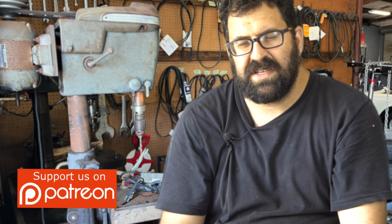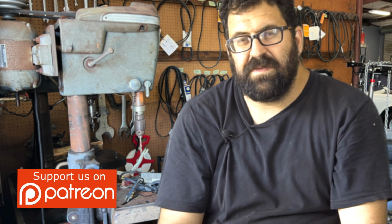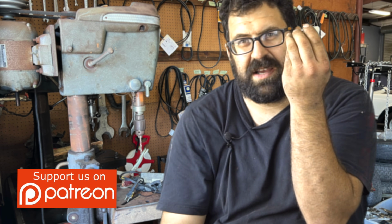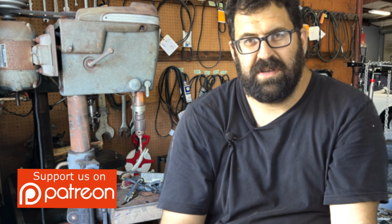So the takeaway from this is I want you to understand that this is a repairable part. Doesn't mean you have to throw your distributor out or get an electronic ignition. A lot of the time, if you go back with genuine Mercedes points, a genuine Mercedes 80001568101 condenser, which is the good German-made condenser, you'll find your engine runs like new, just because of this little tiny repair with an oversized socket and some files. And about an hour and a half to 2 hours of your time to repair the distributor on the bench.